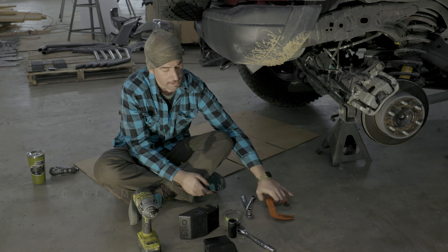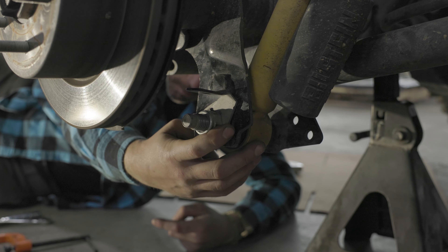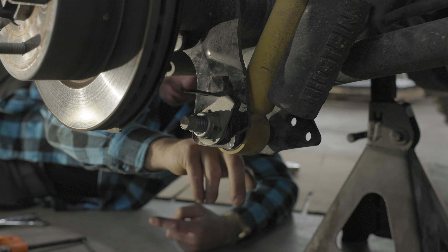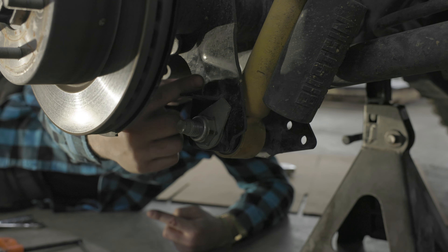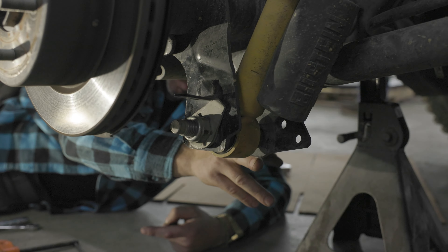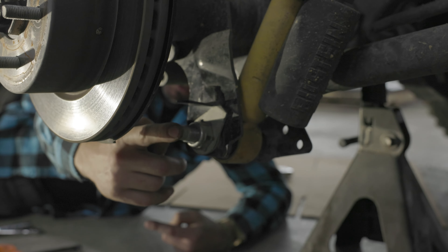All right, so we're going to break this loose. You don't need a wrench because Ford has built in this little tab. This nut here has a little wing — a little ear welded onto the nut. What's going to happen is as I loosen this bolt on this side, this thing is going to swing around and hit this leg up here, which keeps me from having to use another wrench. All you need is an impact on this side and as you loosen it up, this thing will walk itself out. I'm going to loosen it up just to the end — when I feel that nut at the end, I'm going to stop. You don't have to remove the nut all the way.